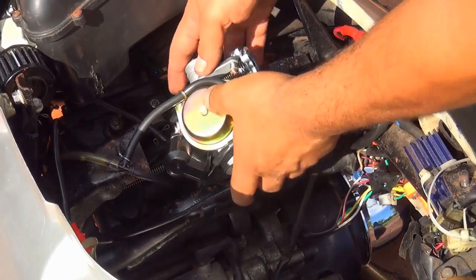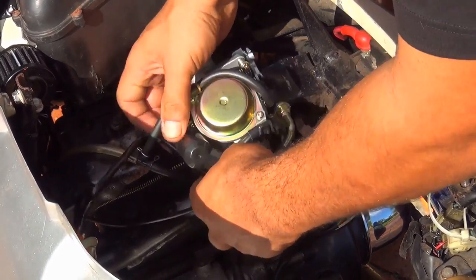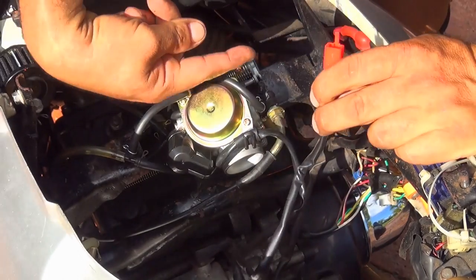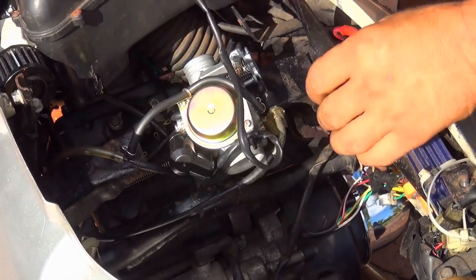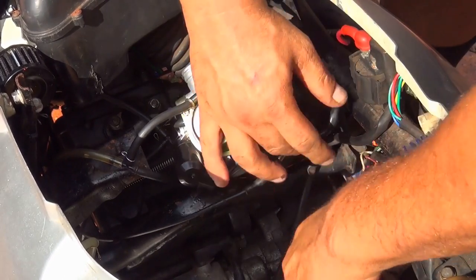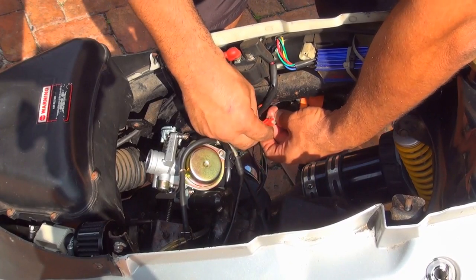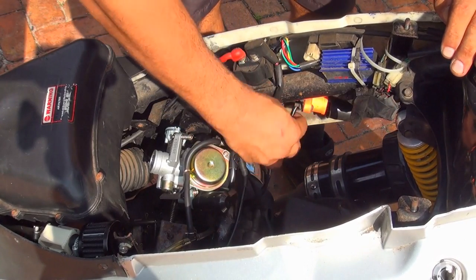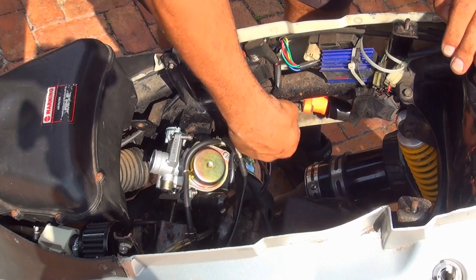Right here you have the enricher connection on the right side of the scooter connected to the frame. Go inside and find the enricher connection and plug it in. Make sure you don't pull the wire too hard or force the connection, because these connectors are made of low-quality material and break easily. With the heat of the motor, the plastic and cables can be fragile when you work on them.